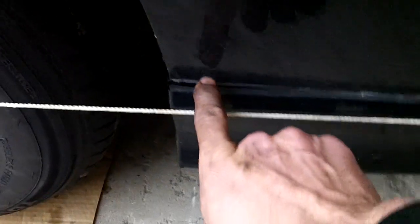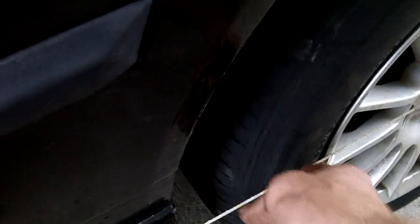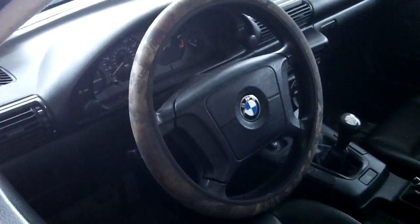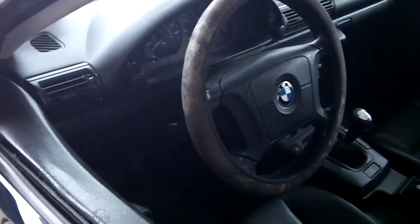Now if we go around this side, we can see we're touching the tire pretty good here. We got about an inch and a quarter here. Our body line, we got about three-quarter, maybe a little bit more here. And it's taut back here again. We also have the steering wheel just about straight — that's where you want it when you're going down the road straight, so that's where we want it when we're adjusting the toe-in.